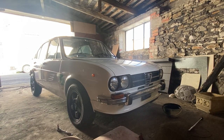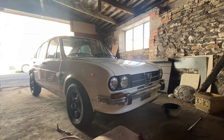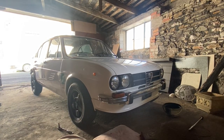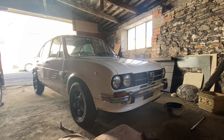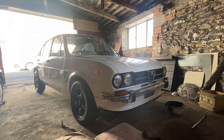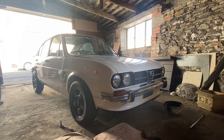Hi guys, welcome to OG Cars. In today's video we are looking at the Italy trip number two car, the Alfa Romeo Alfa Sud, and we're going to be doing a service on it. It did have a lot of work before the Italy trip including a timing belt and service, but it's done a high mileage and when I had to top up the oil it wasn't the right grade, so I figured it'd be best to just flush it all out and put the right oil in for a freshly serviced, ready-to-go car.